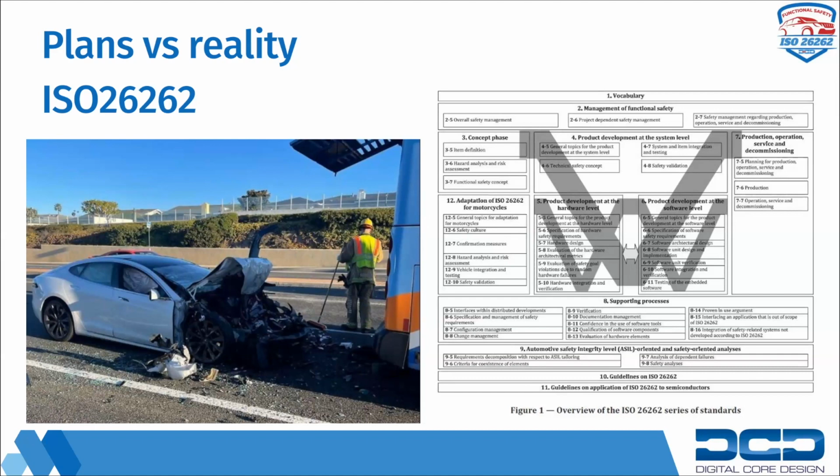To gather an objective evaluation of the functional safety of a product, the Automotive Safety Integrity Level has been introduced. In one sentence, it shows if the design provides a reasonably low level of failures in time. This depends on systematic failures and random hardware failures. The systematic failures can be omitted by a change in the design, proper design procedures, and testing. But random hardware failures cannot be omitted. But the risk caused by a hazard can be mitigated.